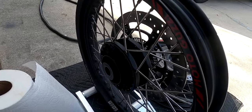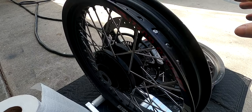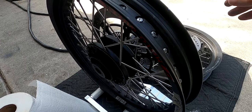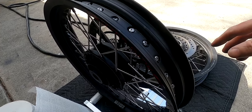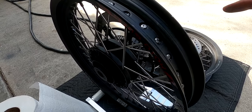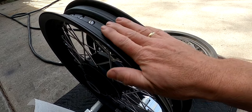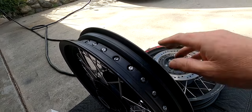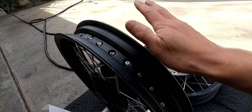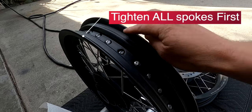This kind of conversion has been done thousands of times — there are loads of videos on YouTube — so I'm not even going to film the whole process. Basically, get rid of your tires, get rid of your tubes, and expose your inner rims. Clean these up thoroughly: blow the dust out, wipe it down with acetone so that the sealant will bond.